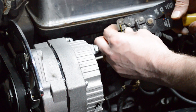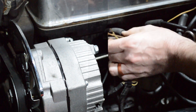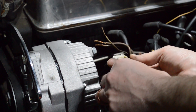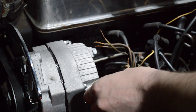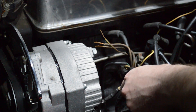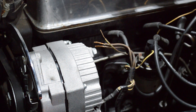Get a new piece of wire on the end of all of these. I cannot stress enough — your power should not be on when you're doing this. Keep the battery disconnected. Your alternator is usually going to come with a plug like this too, so just make sure you look at the wiring diagram for the plug and then connect the right wires to the correct places. In my case, this white wire goes to the indicator wire, and that's what's going to allow it to plug in here. I'm going to solder these. The best part about soldering is that you just heat it up again and you can unsolder the connection. If you're not great at soldering, use a crimp connection, but they're not going to be good long term. If you don't know how to solder, go find a YouTube video — it is a better way to make a good connection.